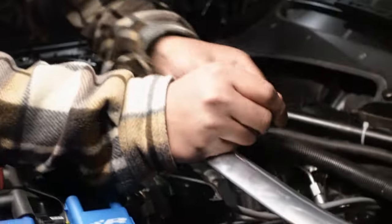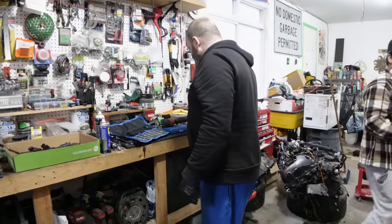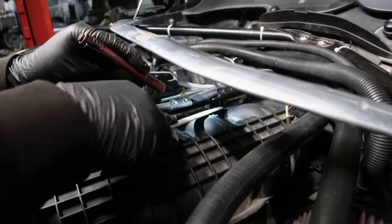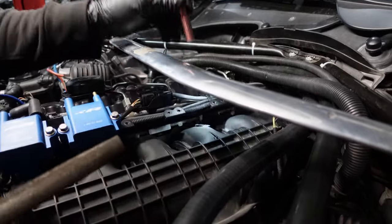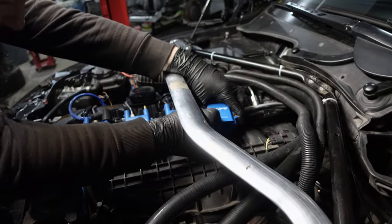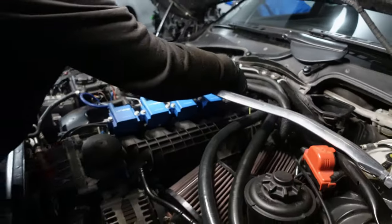Good — there isn't a hole. I knew the entire time. I'm gonna file it down to make it look a little bit cleaner. As long as you don't end up hitting the runners, you'll be fine — so you don't need to worry about this ruining the integrity of the manifold itself. It fits, with about five mil to spare. And you don't even see the portion that we clearanced.